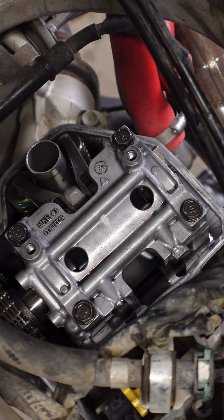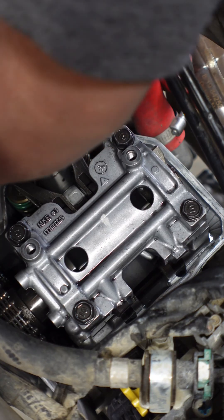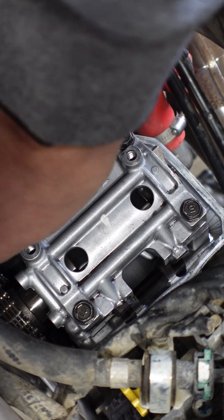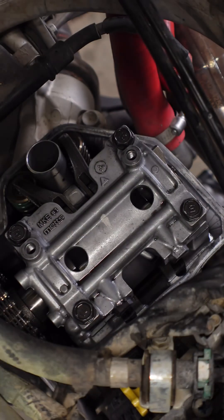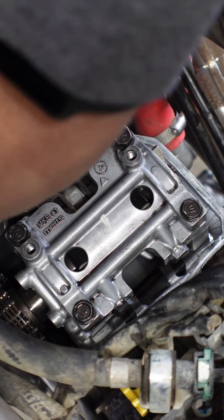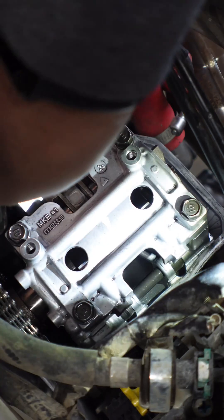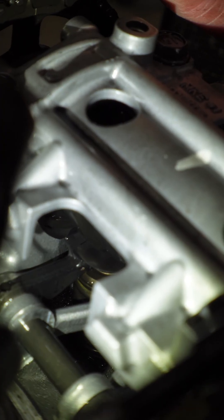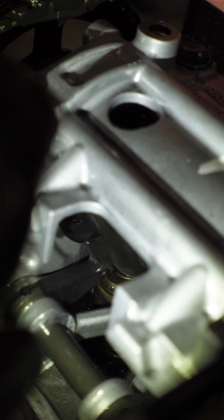This one's a little tighter. What we're going to do — if it's too tight — we're going to go with a smaller feeler gauge. The book says we can go plus or minus one thousandth. If this one doesn't fit, we need to reshim. It does not fit, so we need to reshim this. I'm going to go two and a half thousandths. Once that one fits, I have the feeler gauge in that same spot and I can move it — where before I couldn't put any feeler gauges in there. So that's what we're going to record as this one's measurement.